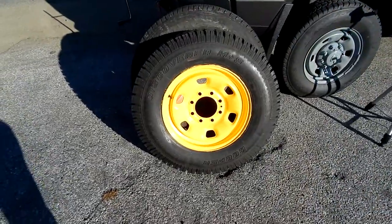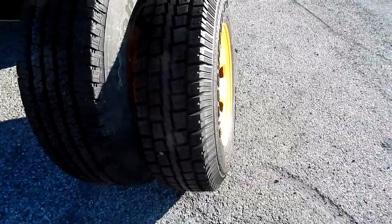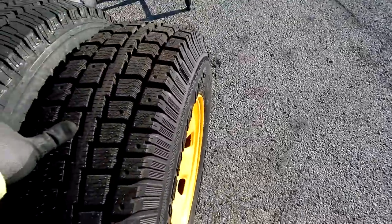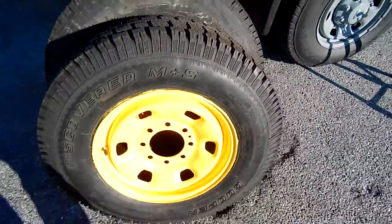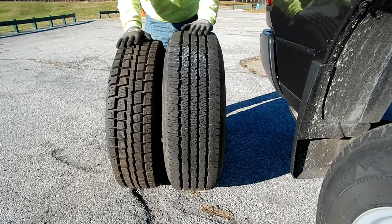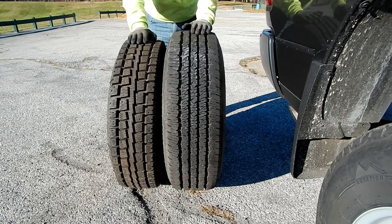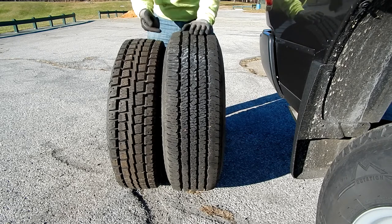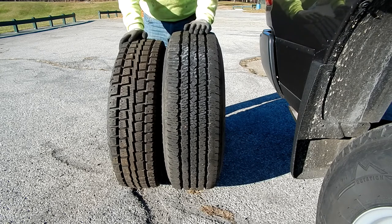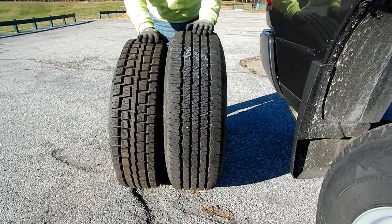As also implied in the title, I even have a winter spare. At a quick glance you can see how much smaller in diameter this 17-inch wheel is. I've been leaning them here on the bumper — I'd never lean it on the paint. A difference this big in diameter could actually wreak havoc on the four-wheel drive system, or even on a two-wheel drive truck. Limited slip differentials are standard on these Rams, so that much of a size difference could really wreak havoc on your differential.